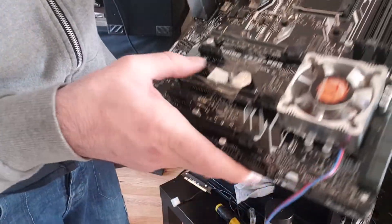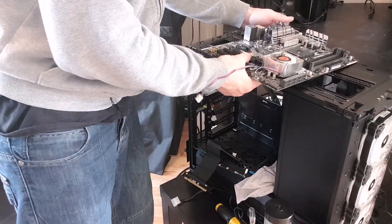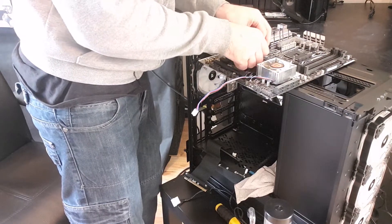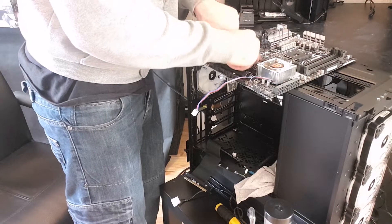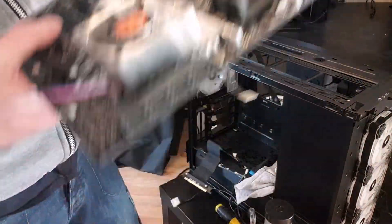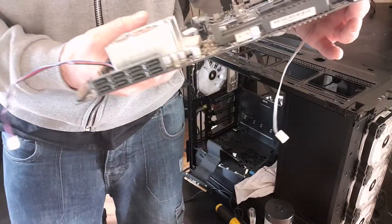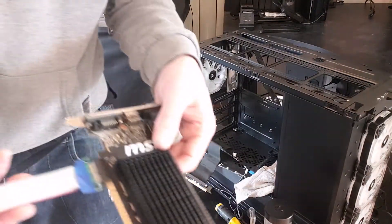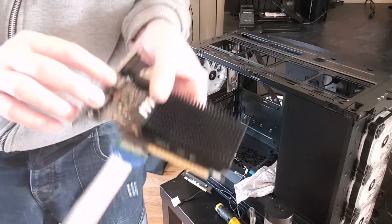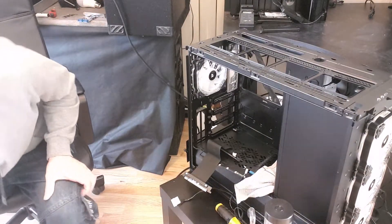I need to cut this edge open so I can get an x16 card in - oh, hang on. You wouldn't get an x16 card in there; there's a battery in the way. It would have to be that slot above it. Cut that, whack a graphics card in there. I've tested it so I know it's possible to run a graphics card from there. Make your own little open end cut. Don't try and run a 3090 from it because that'll be stupid, but a GT 710 is absolutely fine.